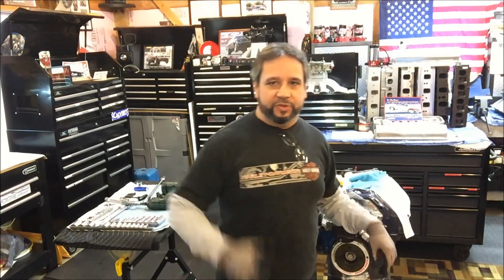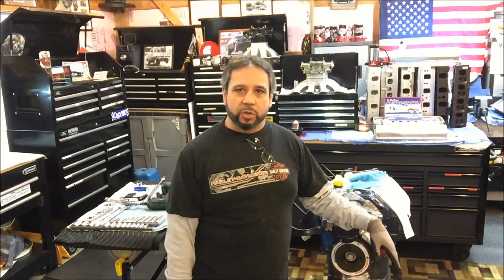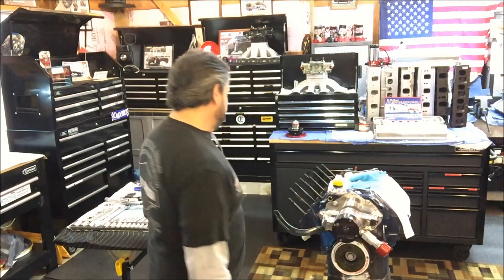Guys, I really appreciate that. I put up a video of Steve's 65 Mustang — that thing sounds wicked. You can tell when the compression gets up there by the way it idles. Everything changes right about 13, 13 and a quarter, 13.5 — right there is when it goes to a different motor. When you have something that's 11 or 12 to 1, wait until you hear that 13. It's the cylinder pressure and cam timing — they just sound themselves.